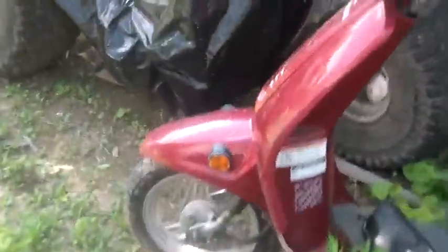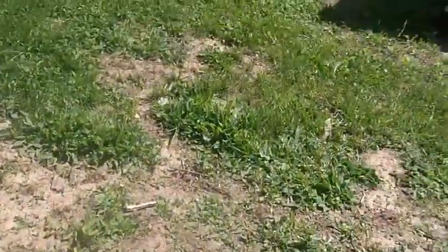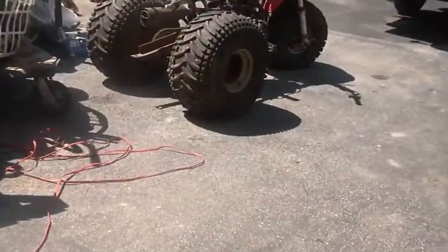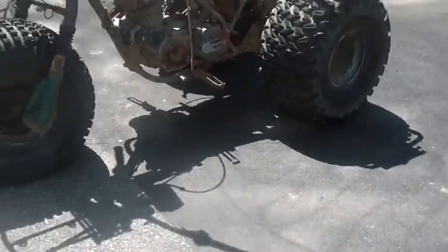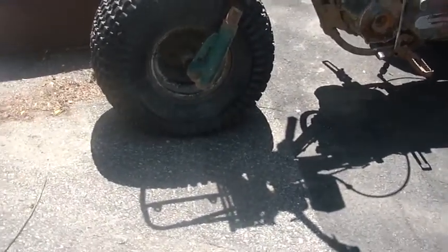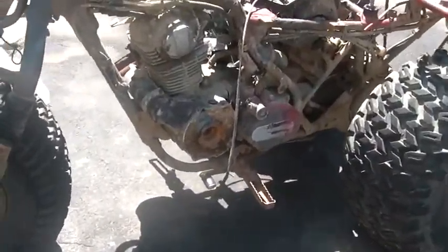Welcome back to the horde. This video I'm going to try to answer a couple of questions. Some of you had discussion about my 200ES - the one that came from the car show up in Rhinebeck. I've been thinking about it quite a bit. I said what was wrong with it was that it jumped time and probably whacked the intake valve a little bit, I lost the compression, and that's why it won't run. Most of that's true but unfortunately not all of it.